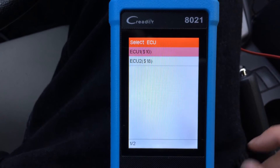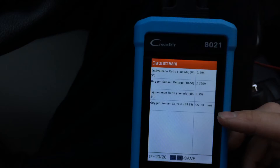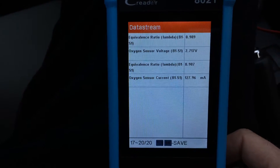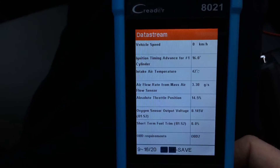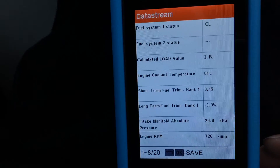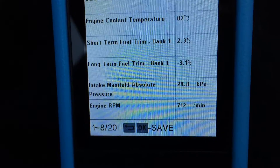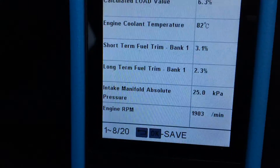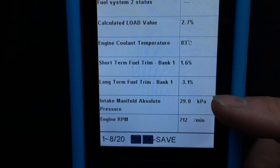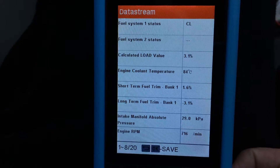You can see all of this data about my car as it's running — my oxygen sensor current, equivalence ratio, fuel system status, and there's my engine RPM. Watch what happens when we rev it up. This allows you to take readings from a running car — it'll tell you the MAP pressure and all these numbers, provided you know what they mean, to find out what's wrong with your car and if it's running within specs.